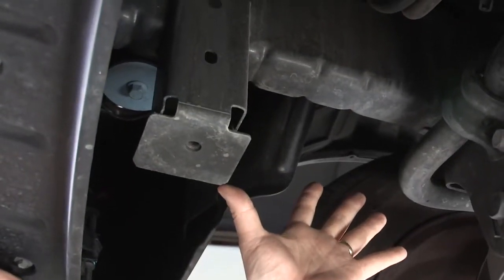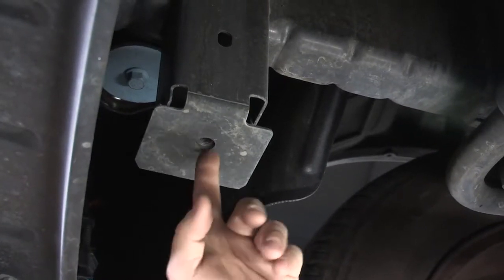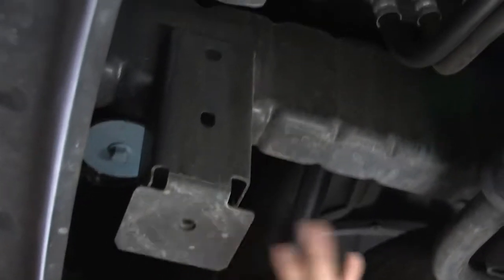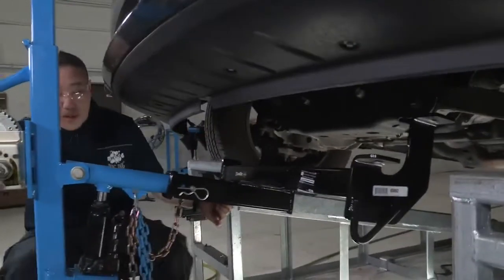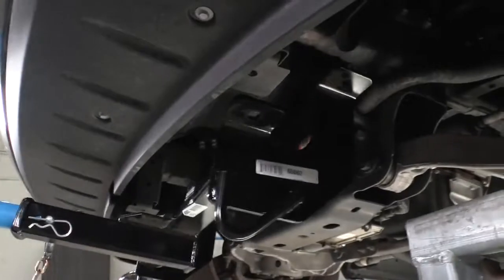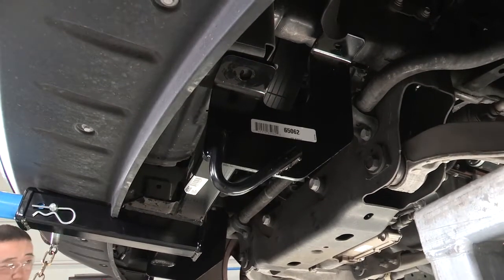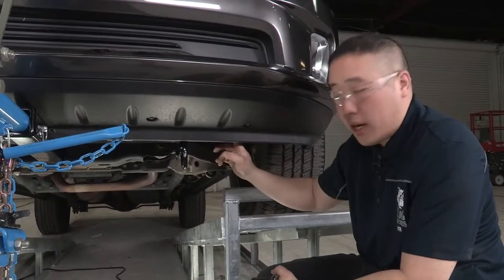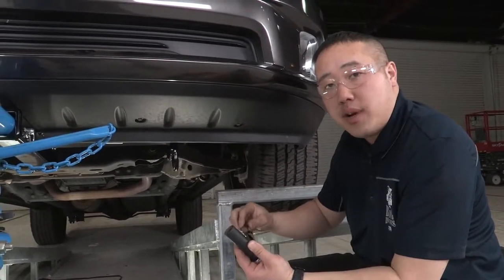Our attachment points are here underneath the vehicle. We're on the passenger side as of right now. The first bolt hole that we're going to be putting in is right here — it's a pre-threaded nut on the inside of this frame rail. One on the passenger side, one on the driver's side as well. Once we have that up into place, we'll be using the hitch as a template to drill a hole in this area for our secondary attachment point. Now once we've got these bolts in place and started, you'll want to tighten them down because we'll be using the hitch as a template to drill. You don't want the holes to move around, so tighten these down so it's snugged up and doesn't move, and then we can go ahead and drill our holes.